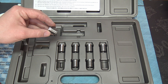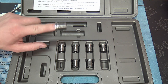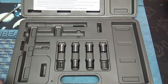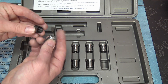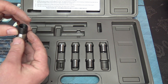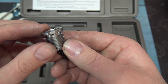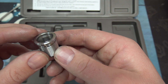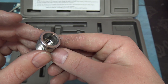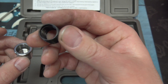That extra torque will make it hold, and at that point it should be a permanent repair. These inserts are nice and thick compared to any others out there — beautifully machined with a tapered seat built right in. Being thick, they'll handle the heat and transfer it without distorting like the thin inserts will.